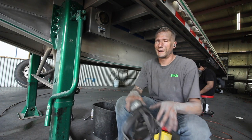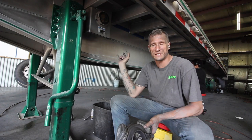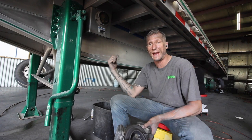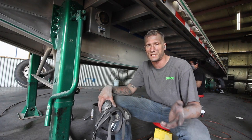Finishing DA in here. It's gonna be a little loud. Now I'm gonna rotary over the top of this, and I'm gonna rotary the whole entire thing one more time over the top of the DA, and then we're gonna come back and do the DA again. We're just gonna keep alternating back and forth. The reason why we do that is we wanna make sure that our previous sanding is complete. We don't wanna jump steps.